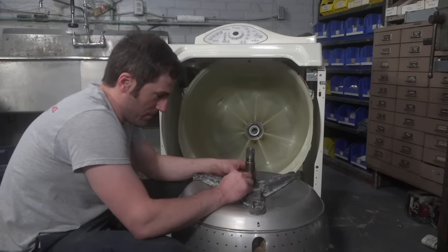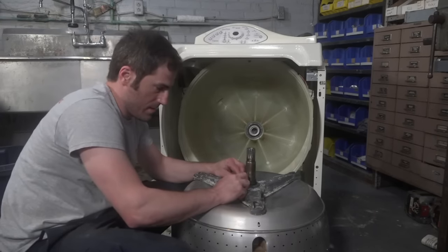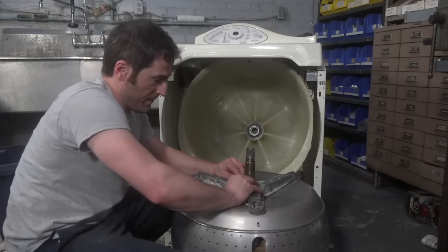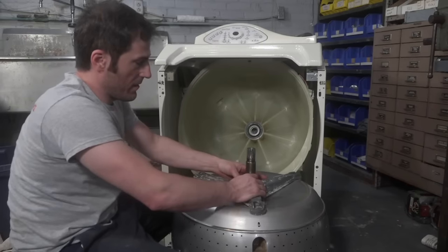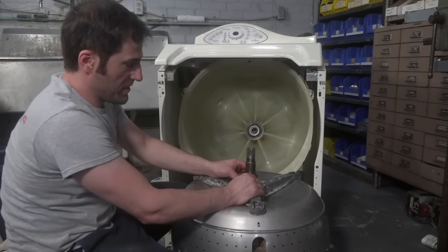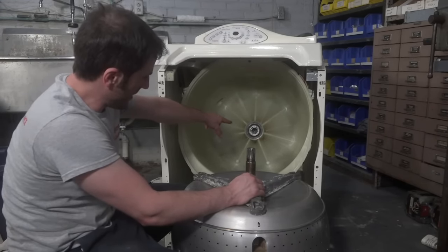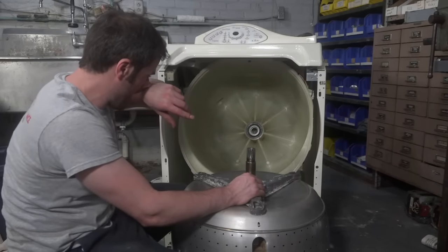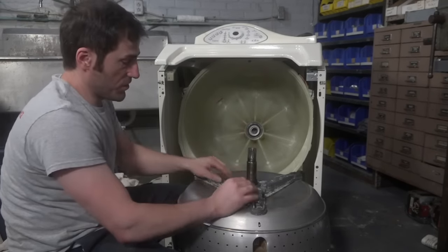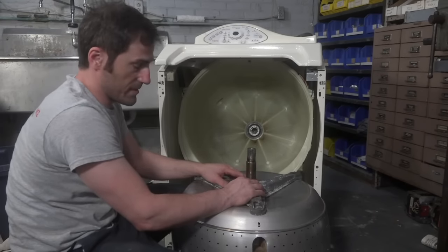And so the O-ring goes in the very bottom, all the way down. There's actually kind of a groove for it. It'll squeeze in there as you push this in. This little O-ring is going to sit against that little inside lip of that metal seal. And then when you tighten down the bolt, it squishes it and kind of puts it in its place.